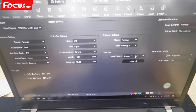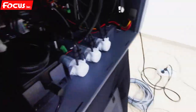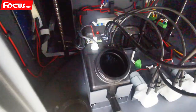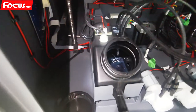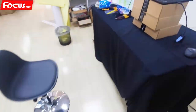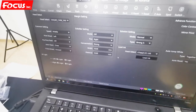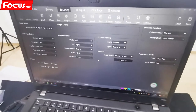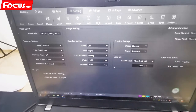Once the ink is coming out, close it off immediately. Let's try: we choose head one, two, three, then go to load ink. The cap station will move up and the waste ink pump starts working. We wait for all the ink to come out — we can see white color varnish all coming out — then go to the software and stop it immediately. This way we can save a lot of ink, and it is only used for the first time we load ink.